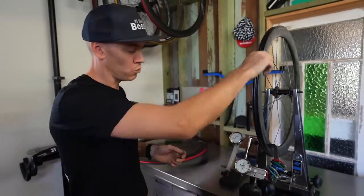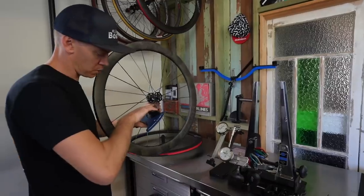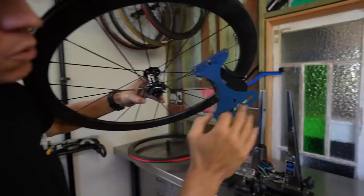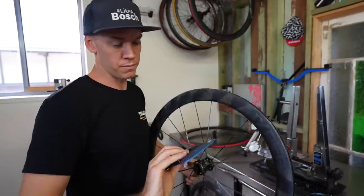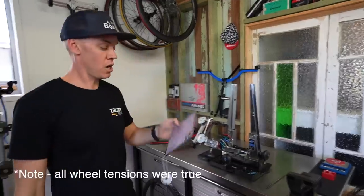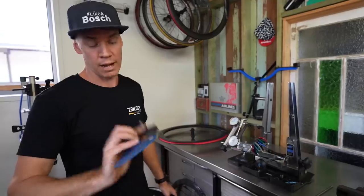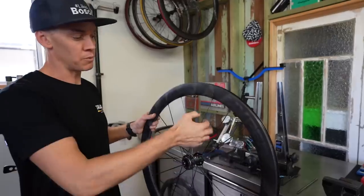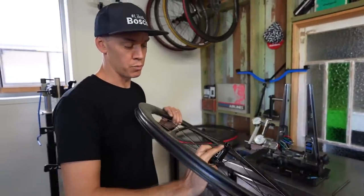Here are the spoke tensions. All it's doing is taking the blade of the spoke and releasing pressure. Every brand has a different suggested kilogram of tension — it spits out a number, say 20, and you look at the spoke profiling on their chart and compare spoke tensions to where it should be. Most shops would have this tensiometer. If you do it up too tight you're going to crack the rim; do it too low and you'll end up with your spokes breaking.